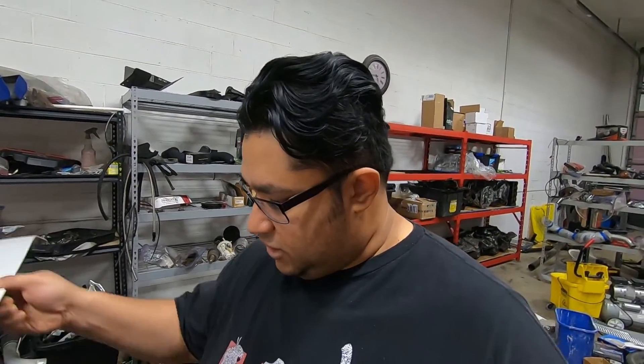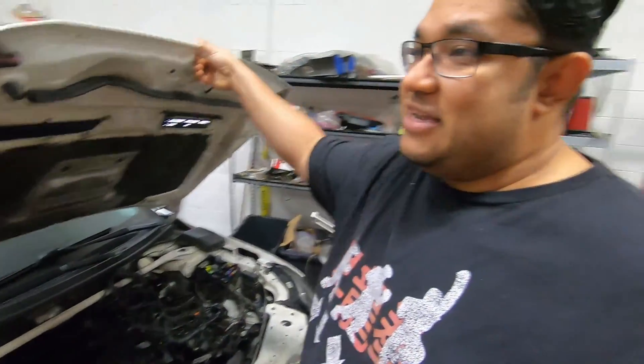You still have to keep the MAF plugged in because it has the IAT sensor with it. You basically put 655 or whatever the highest value is on the MAF horizontal axis, and it tricks the system into only using the MAP sensor — but you still have to have it plugged in, so it kind of defeats the purpose. I'm used to Corvettes which have a MAP system — it's very good for daily driving and very rewarding when both work together. It's also easier to diagnose things because you can read both a MAF value and a MAP value to find a leak.